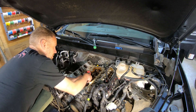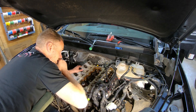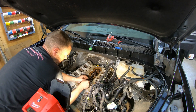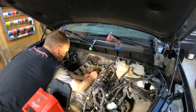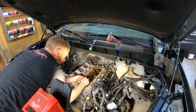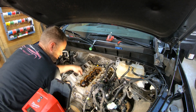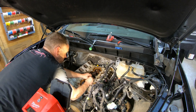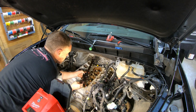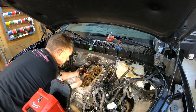Let's go ahead and zip this apart and see what we're actually working with. First things first, I've zipped the bolts out, but I'm going to get these connectors all disconnected for the solenoids because I'm going to leave them in there to pull the harness out. I believe there's something probably holding them down into place, because otherwise they'd be pushed out by oil pressure. This is my first time tampering with one of these, so this should be an interesting experience. There is the pass-through harness and connector — this thing goes through the cover, seals via an O-ring, and controls all those solenoids.